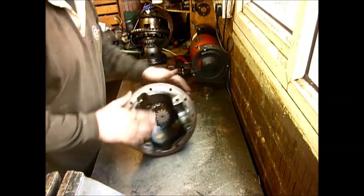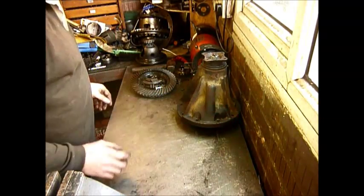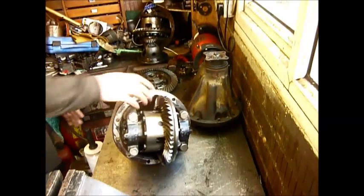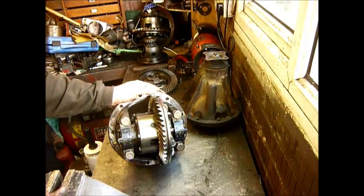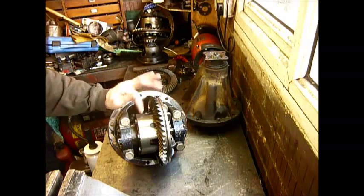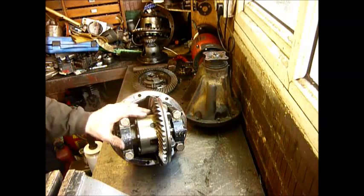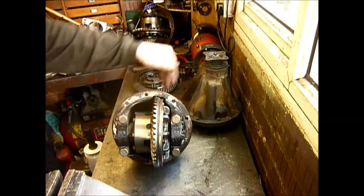This is a diff that I've recently just hauled apart to find out where it had some clonking noises. Down here is a short nose diff. The short nose diff is fitted to late 110 rear axles, P38 some flavors of rear axle only. P38 diffs come in two-pin and four-pin — this is a four-pin — and they are extremely different to your standard short nose and long nose units.